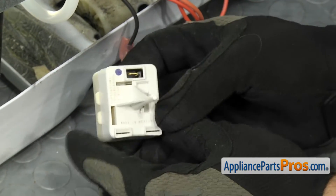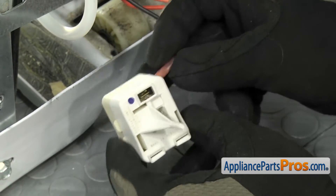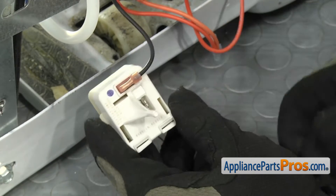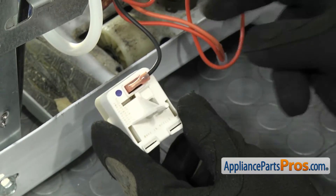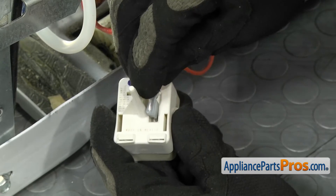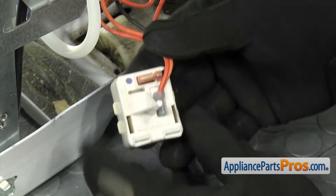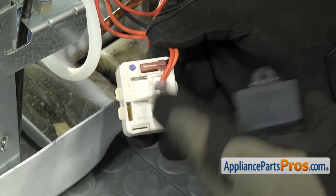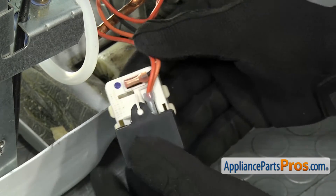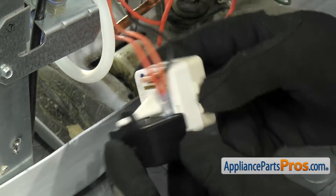We're going to attach the wires and put the capacitor on before we install the new compressor start device. We're going to put the black wire on this terminal — this goes directly to the overload, just like the old one. There's no L or N on the new one to signify that, so just make sure you put the black one up there. And we'll put the double orange one here — this goes to the relay. Once you have those pushed in so you have a good connection, you can put the capacitor on. You just have to slide it down this post right here, and you want to make sure that the terminals go into these little openings. Once you have it snapped in, we can put it into the refrigerator.